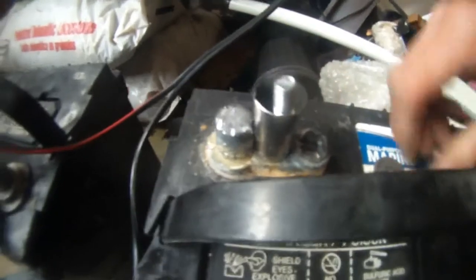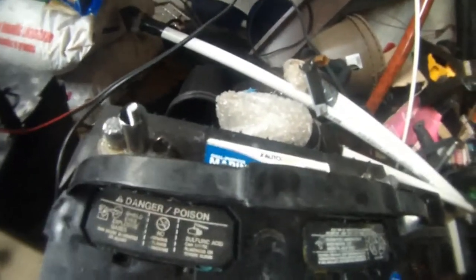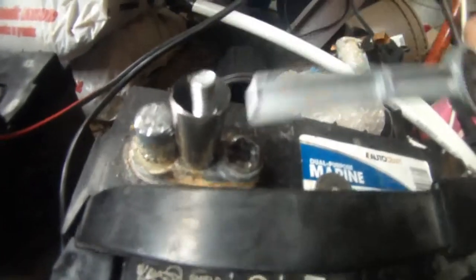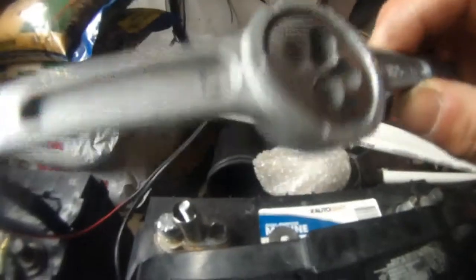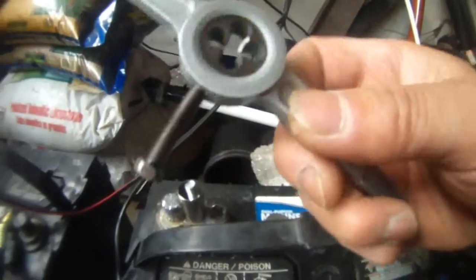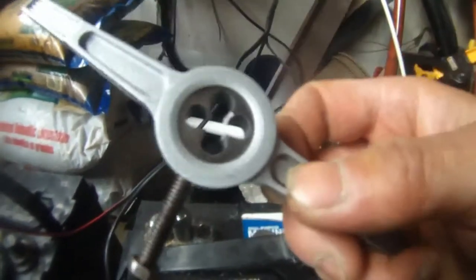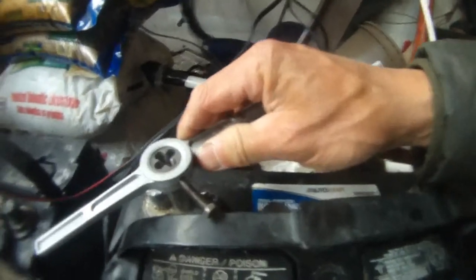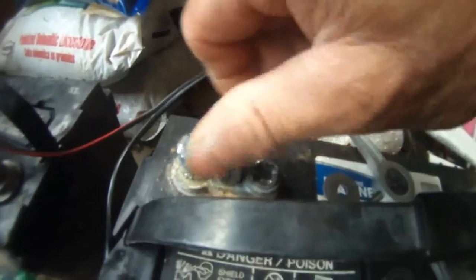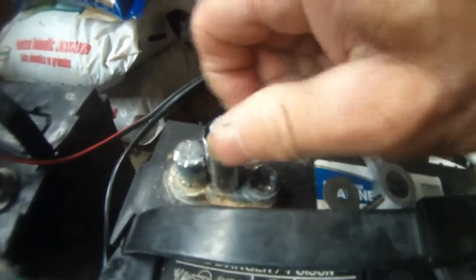What I try to do is use my die and tap tool, because the screw thread on this screw does not fit the 5/16ths inches. So I have to use the 5/16ths die to thread this — die and tap — so it's the tap to thread this screw down so I can fit this nut onto here. As you can see, it fits into there perfectly.